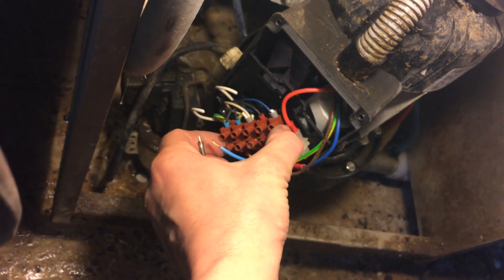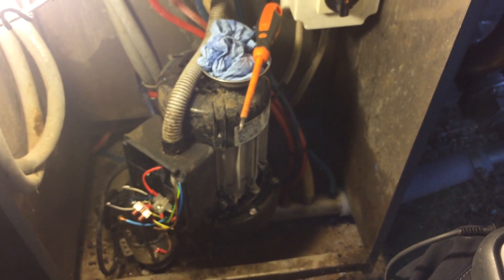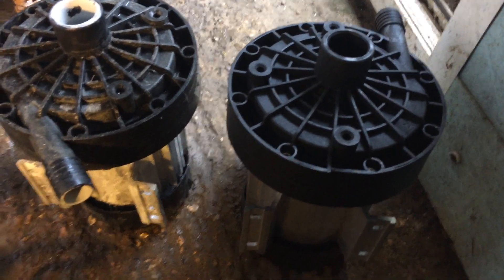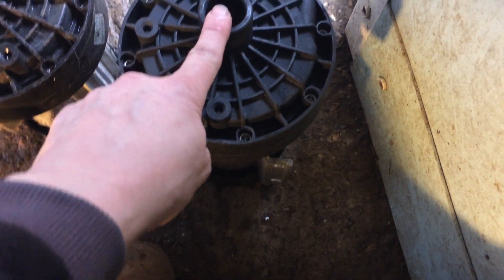With just the motor windings and the thermistor connected it's still shorted — so time for a new one. Luckily we've got one in stock. We're going to drill an extra hole in here because the factory ones from the pump manufacturers don't come with it — the mounting brackets are closer together on these. Also the outlet is in a different position.